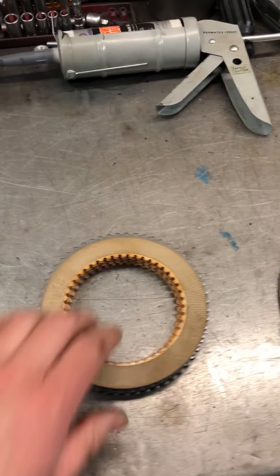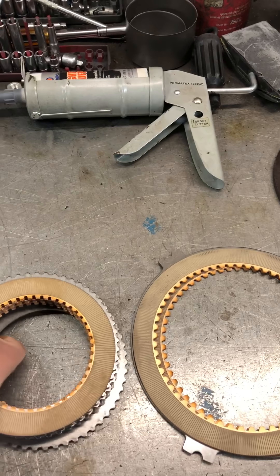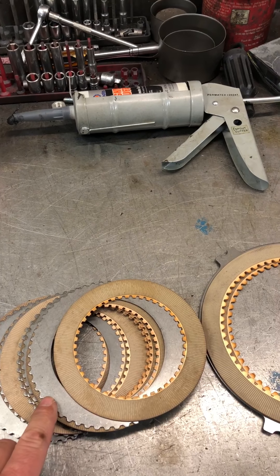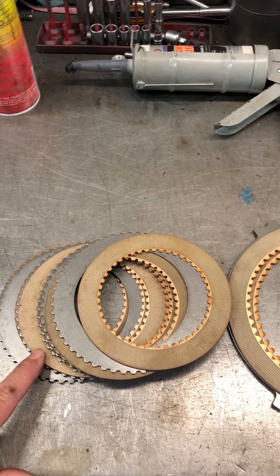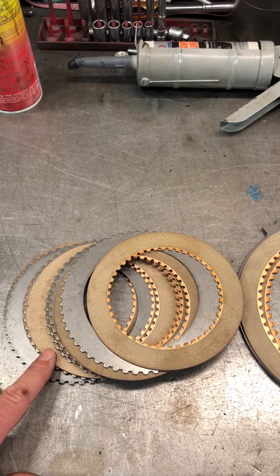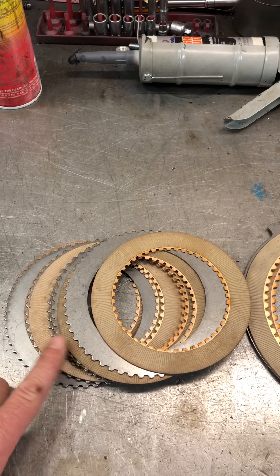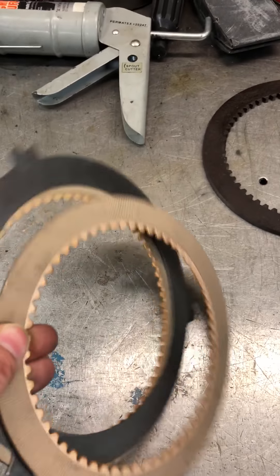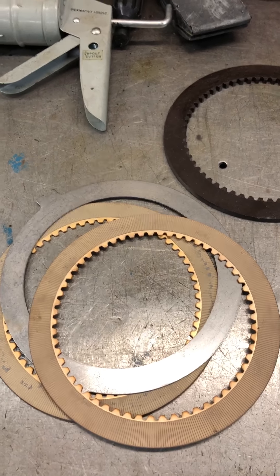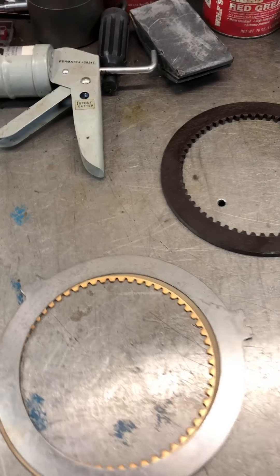What I'm going to show you now is the actual clutch differences. This is a forward clutch pack out of a 1018 transmission — 13 plates total: six frictions and seven steels. A 71 Series or 1017 is only nine plates — five and four — so it's just less holding power. This is the reverse on a 1018 or 72C: three total plates — two frictions and one steel. On a small block it has one less friction, so we lose some holding power in reverse.